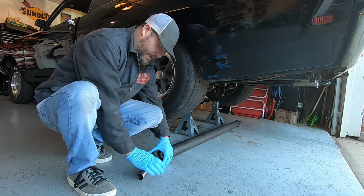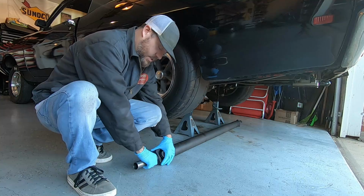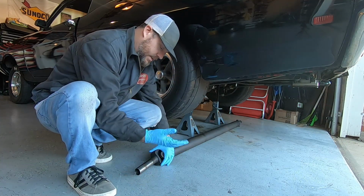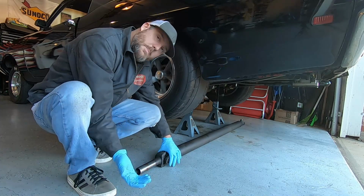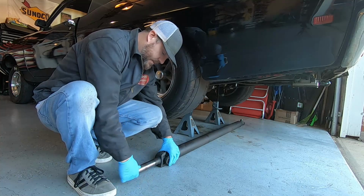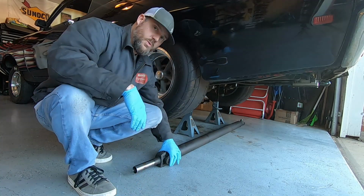So I've got a leak because the tail shaft bushing is leaking, and this is completely dry, which is not good. There's just not enough fluid in the transmission. It's amazing it's been driving. I do check the fluid and I top it off often, but it must be coming out of the back of the tail shaft so quickly and so often that it's just not working. So really I shouldn't drive the car until we resolve this issue.